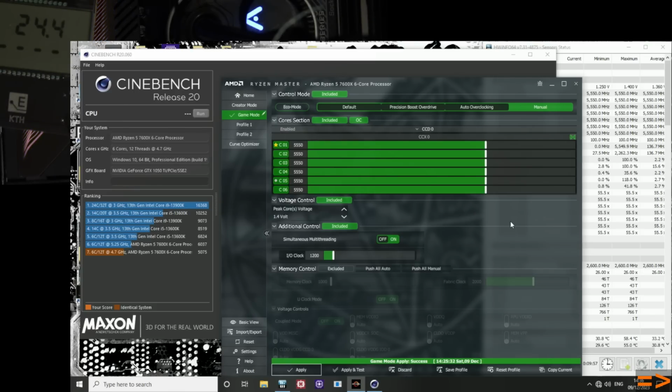I was just running Cinebench, and I ran into voltage rollover relatively quickly at not even that insane temperatures. Because what voltage rollover is: when you're overclocking and you're raising the voltage in order to improve stability at high frequencies, the idea is basically if you just apply more voltage to the transistors, you can switch the transistors on and off faster. The side effect of this higher voltage is, of course, increased power consumption and higher temperatures. Now, the voltage rollover effect is due to the temperature component of increasing voltage, which is a consequence of the increased power consumption.